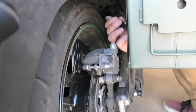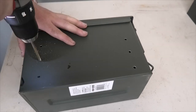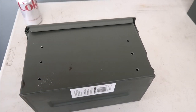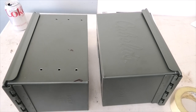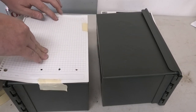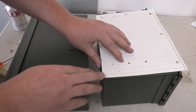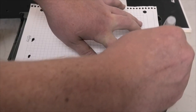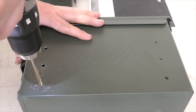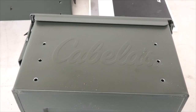With the tape holding the can in place, I took a Sharpie and marked all the holes on the brackets on the back side of the can. Then I used these markings to drill holes in the back of the can. Since this bike is symmetrical, there's no need to go through all the hassle of mocking everything up on the other side for the other can. I simply used some paper to make a template of the first can's holes and mirrored it onto the second can.